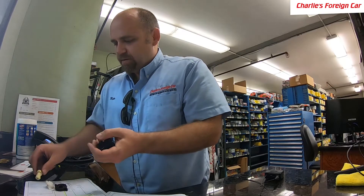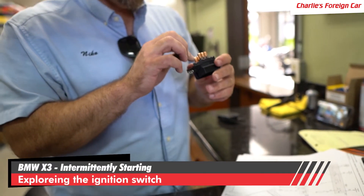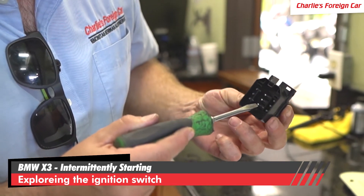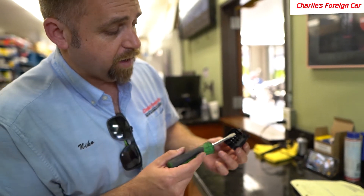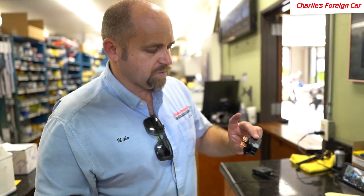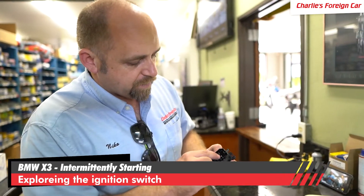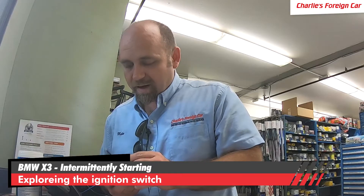Here's the cam that we just removed, and here are all those pieces. We're trying to look at that contact way down there. We're going to pop the power out. It looks like these three center pins are powered, and then these are outputs that the switch gives power to various components in the car. Pin number eight is the starter. These others likely power fuse boxes, turn the radio on. This little box turns the entire car on — fuse boxes, lighting, radio, alternator, everything works off this component, and the power comes in through here.